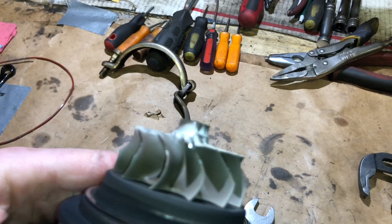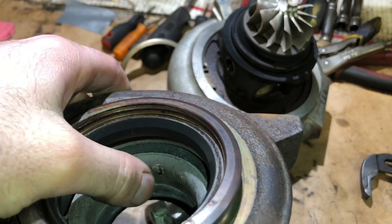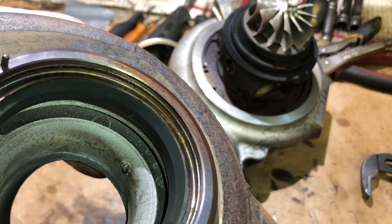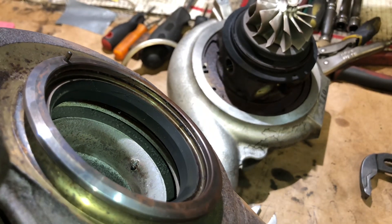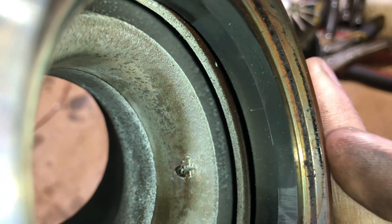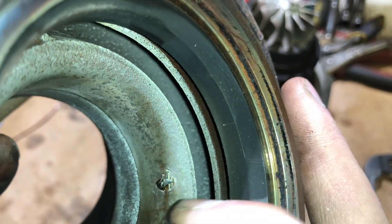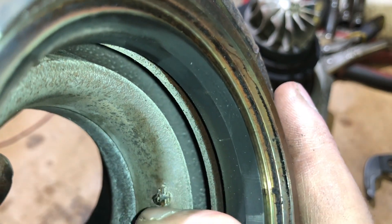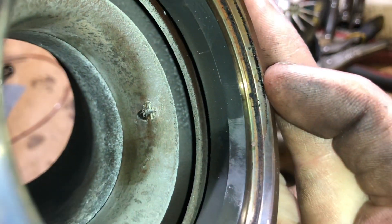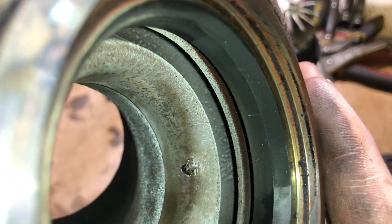See how it tore up the blades right there? It's got that little piece right there. All that really needed to happen is that just needs to be ground out of that housing, and then this turbo wouldn't have any resistance there anymore. It's got a split right in the housing. What I think most likely happened — I've kind of seen this before — is just the housing gets hot in one area, and then all of a sudden it starts to expand out. I think that's what happened rather than something actually getting down in there and getting stuck on the housing.